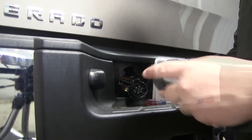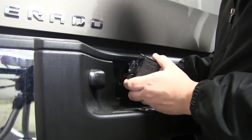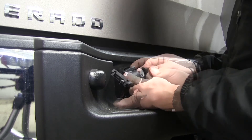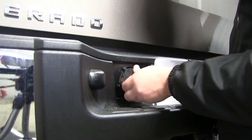Now we're ready to connect our 7-pole trailer connector. To install the replacement socket we want to slide it into position until we hear a click, and at this point we can reinstall the lock. Now we can slide it back into the bumper by lining up the notches and rotating it until we feel it lock into place.